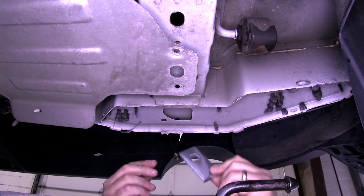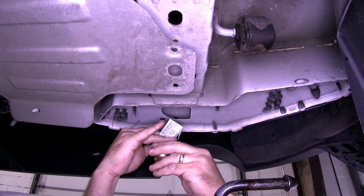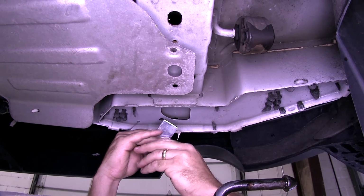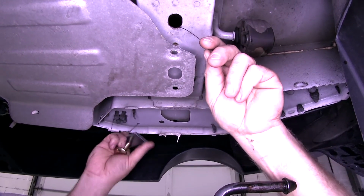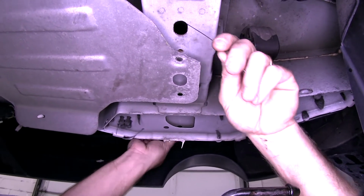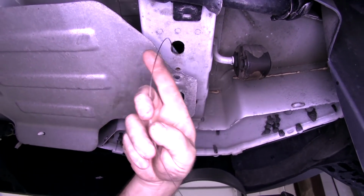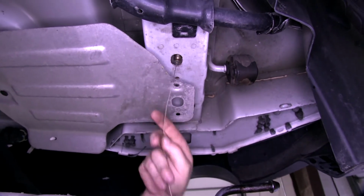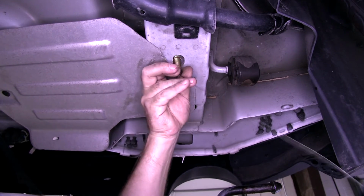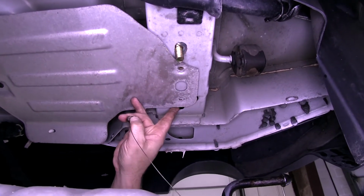Now we'll take our square hole spacer block, feed it onto the bolt leader, followed by our 1.5 inch half-inch carriage bolt. We'll then feed the spacer block and carriage bolt back into the vehicle's frame and pull it down into position. Go ahead and remove the bolt leader. And we'll repeat that same process at this mounting location here.